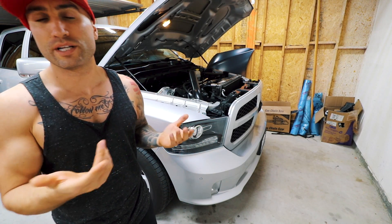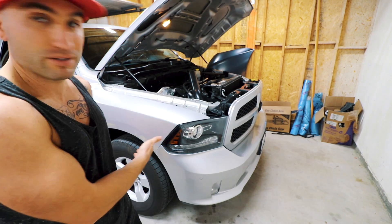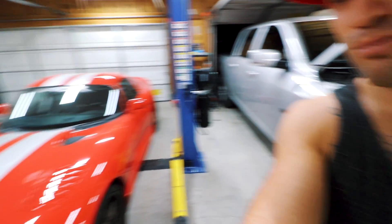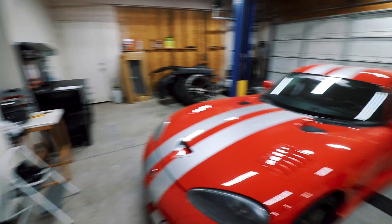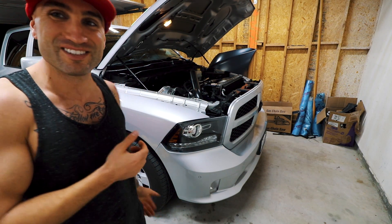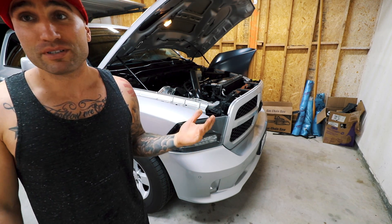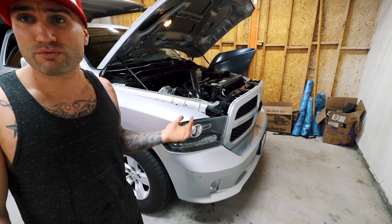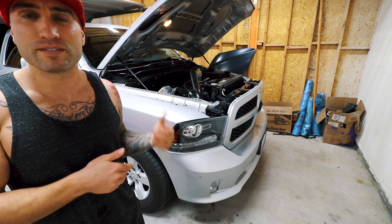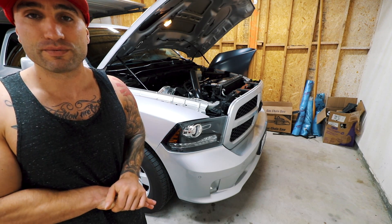Let me know if you guys have any questions about the setup. It's been working well, and I'm going to the track soon — we're going to be getting drag radials for the 17-inch rears. I still have the 24-inch wheels but I've been enjoying the sleeper mode with the 17s for better gas mileage. As for the belt, I might swap it out or try cleaning those steel pulley surfaces first to see if that fixes the squeal, and I'll report back.